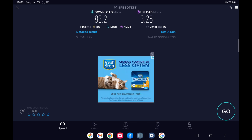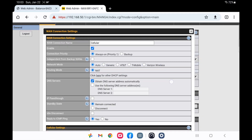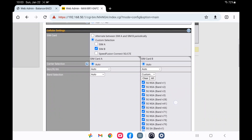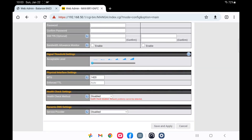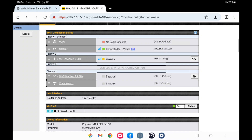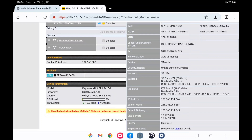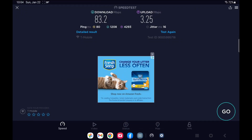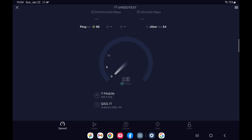On the auto setting, you might want to check other bands as well. So I'm going to go back into settings and tell it not to use band N41. After saving and letting the modem reset, I can see I'm now on band N71, still on band 2 for the anchor. Let's run the speed test to see what happens on N71.